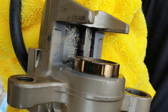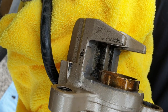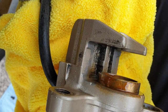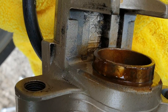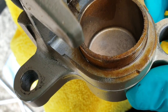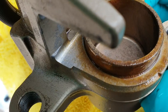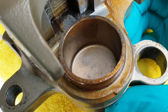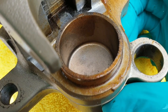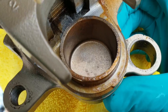Anyway, there she is after a bit of a clean. You just dust around it — so the copper grease sinks down into that groove between the piston and the caliper body. Does that make sense? That keeps the corrosion out. Obviously as the pads wear the piston moves out, but that copper grease tends to stay sat down in there.